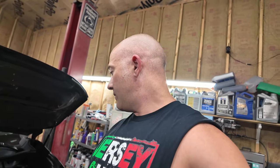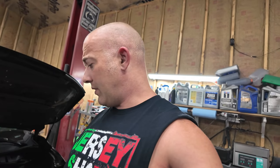When I have problems getting everything to get into the system, you have to start the vehicle up, you have to turn the AC on full blast, recirculate, all that stuff. Then you hook this up and it'll charge, it'll take it. And every time the pump kicks on, it'll take a little bit more out. Sometimes it takes forever to do it. And heating up the bottom of the bottle will sometimes help those gases get out. So I'm going to total it up, try to get everything out of these that we can. And then, hopefully this system will be good.